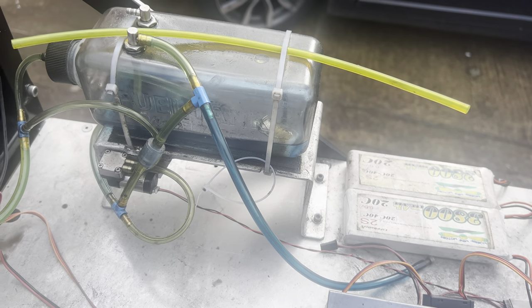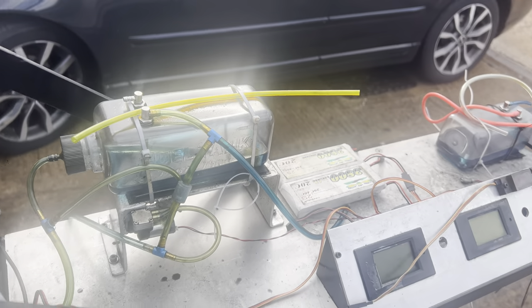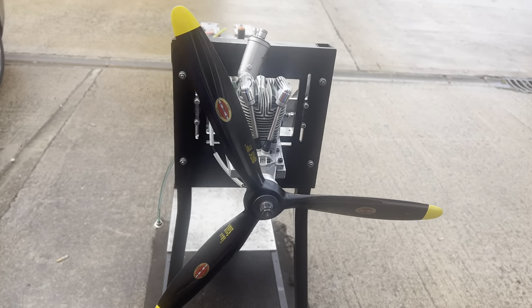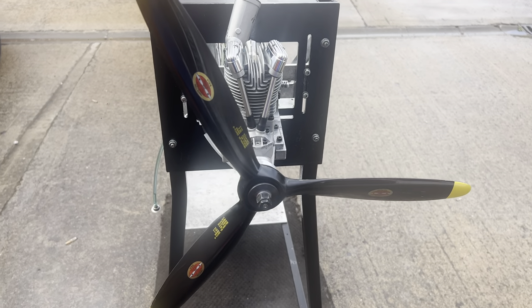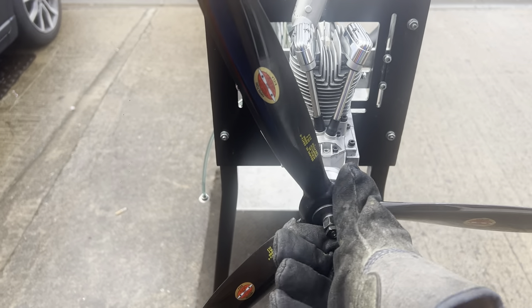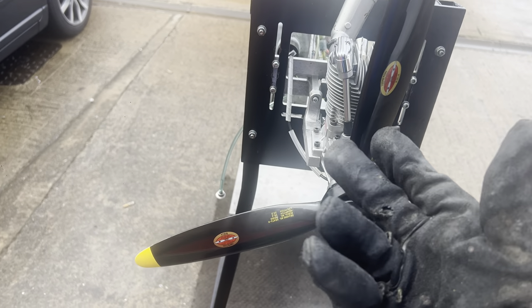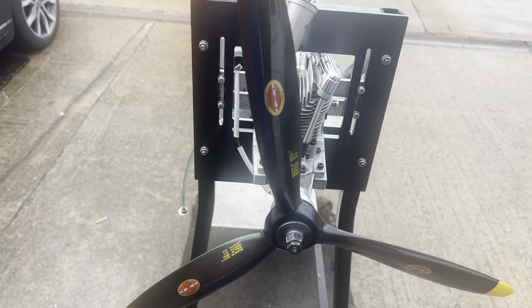Engine sets up really low idle, so I'm going to try to give it a swing. On the top end we have seen over 6.5 — 6.7 to be precise — with this prop. So quite good top RPM combo with this prop and carburetor setup.